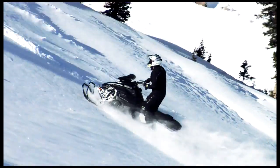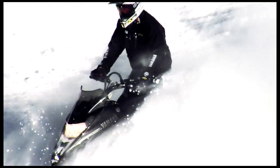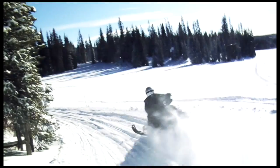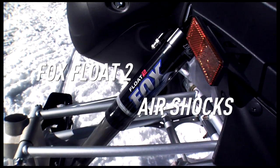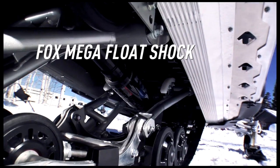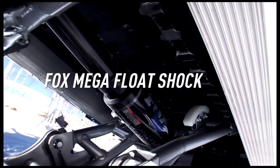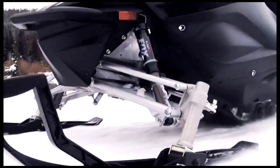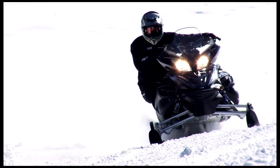The Apex SE advances what we learned from last year's Nitro MTX SE — the lightweight, all-air suspension direction — and applies it to a trail sled. Up front, you'll find premium Fox Float 2 air shocks, and in the Monoshock 2 128 rear, we have the new Fox Mega Float shock. All three shocks are air-tuned with a small hand pump, delivering a very supple, plush ride for all-day comfort.